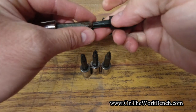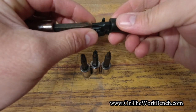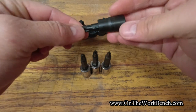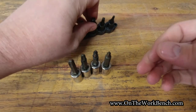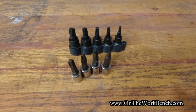These are intended to provide higher leverage on certain fasteners, and this design was developed by the Phillips Screw Company. The MT2 is much closer in size to a Phillips four. These are commonly used in seats and other body components that need to be firmly attached and held together.